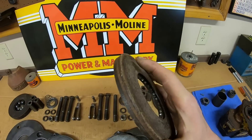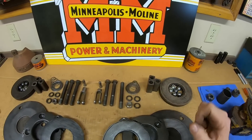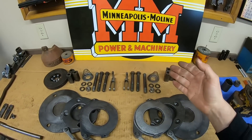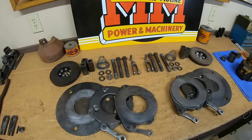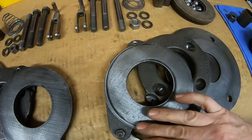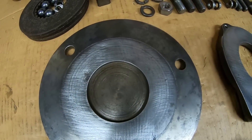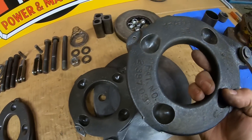Brake discs: three of the four were just about the same. I'm assuming they started out about a half inch thick — if so, three of the four had about a sixteenth of an inch worn off max. But this one right here, you can see the friction material on the inside is pretty close to giving up. Being that we had wear on all four of them, I decided to order four new brake discs. The pressure plates are not bad. The ones on the left looked like brand new. The ones on the right had a little more wear. I roughed them all up to give them a fresh checkered surface finish — that helps the new shoes wear in a bit better. The ball ramps all looked really good with no grooves or catches to worry about.